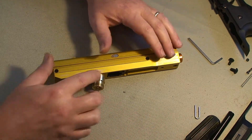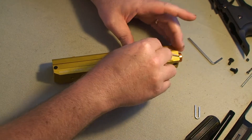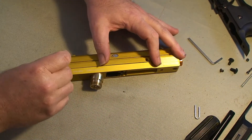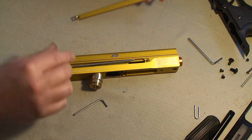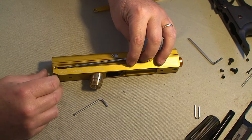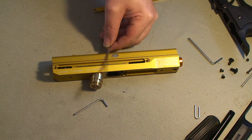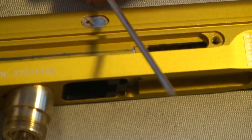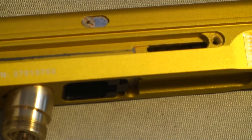Next we will remove the cover plate for the connecting rod — there are just two screws for that. Set the first aside, then the second screw, set that aside as well. You'll notice the connecting rod is sticking out because it is broken. We'll remove it from the striker pin in the back. Here's a close-up of that broken connecting rod. We'll set that broken piece aside.